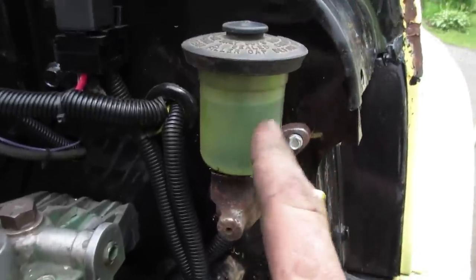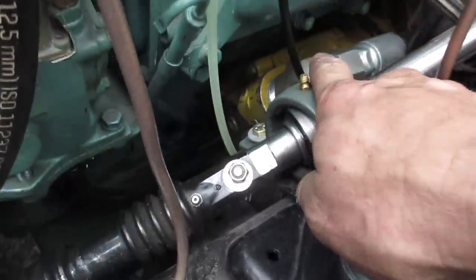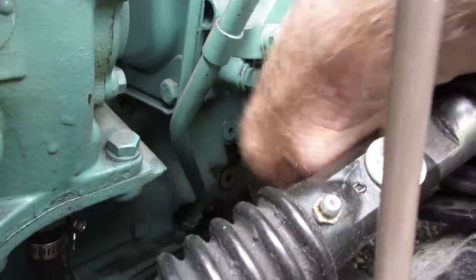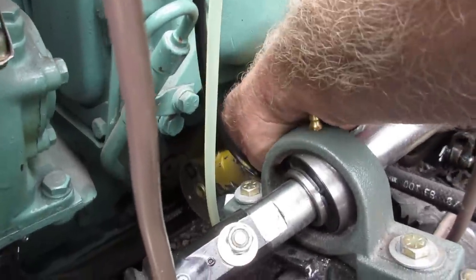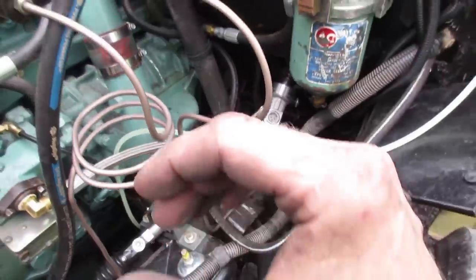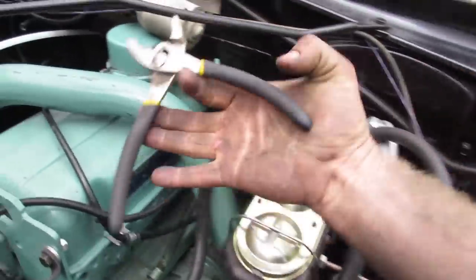This is a little diesel to lubricate the starter, and you can see that it's spraying it nicely right over the side of the block because it has vanes in the back of here. This is your air coming from your tank, and then the vanes slide out and hit the housing, but you need to lubricate that. So you have to keep that topped up, and that just sprays over the side of the block.